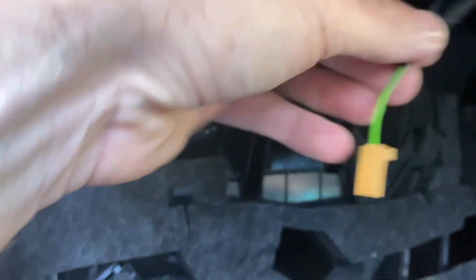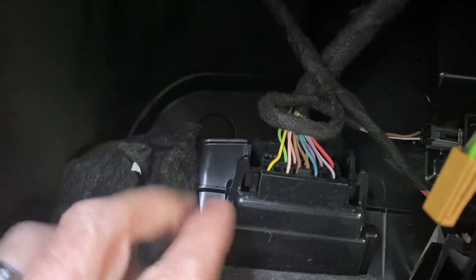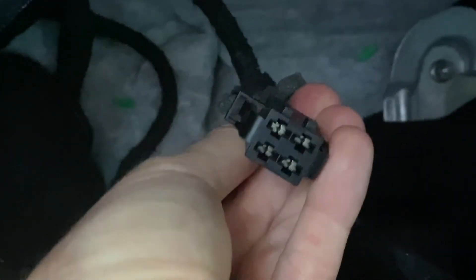I've disconnected the cable that was going into the speaker. There is another connection here as well, but you don't need to worry about disconnecting that. The factory harness we're looking for is a little hard to show but it's located right here. When you first get in you'll see there's some foam surrounding the harness — I've taken that off. If you have the factory tow hitch installed, this is your adapter for your brake controller, and it's usually tucked in right here and easily accessible.